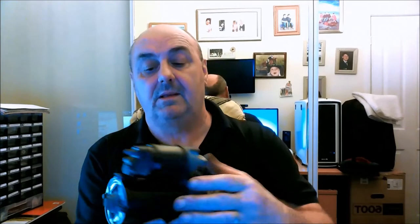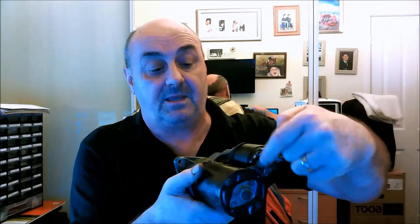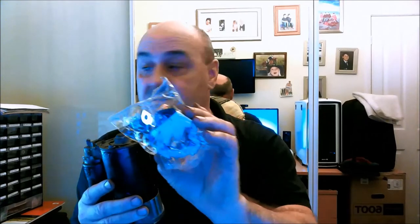I went out on Monday morning, pretty cold morning, put the key in, turned it, the starter motor did half a revolution and died. Now we need to take the bits, find out what's going on, get it back together. I have got some parts here that I have bought — a new set of brushes — because I believe it's the contact between the solenoid and the input pin to the motor. There should be a small braid of wire in between here and it looks as though it's just rotted off and dropped off. When I picked the part this afternoon you can see in there the new spade with a braid on it. The man at Auto Diesel did tell us it's a fairly common fault with these motors. So I'm going to tear it down, put the parts in, test it, get it back in the car, hopefully job fixed.